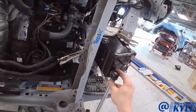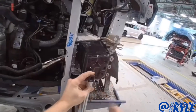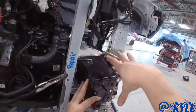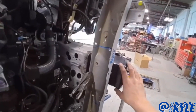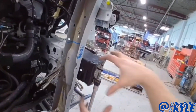This shows the importance of using a measuring system. Everything appears like it's sitting exactly where it's supposed to. However, when I measure it, I have this slid in there about seven or eight millimeters too far. On this design, it's completely possible to have it sitting too far and have all of this still line up. So I'm going to take this and bring it back out.